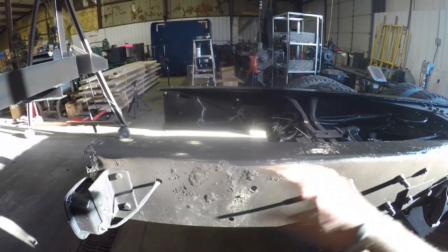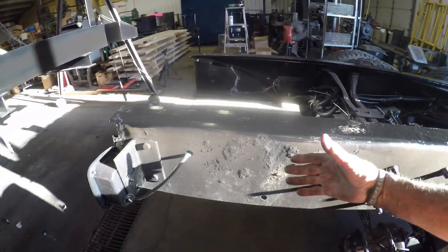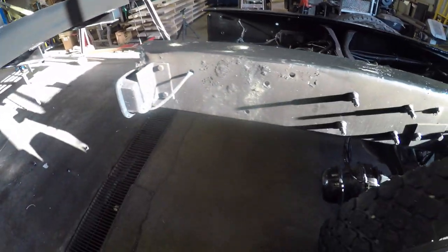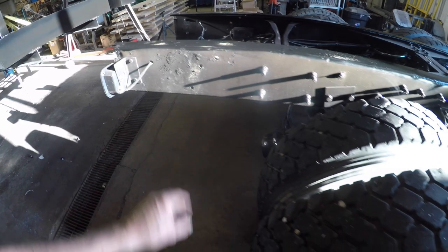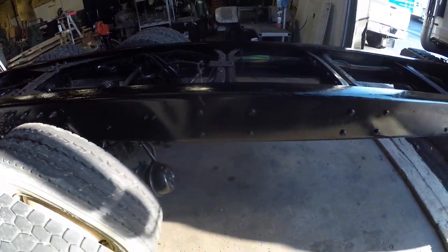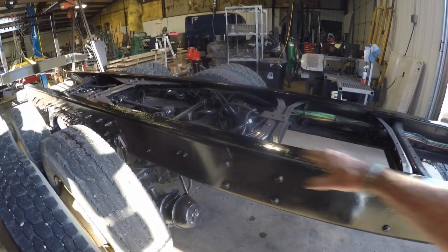I didn't take the entire surface down to bare metal. Besides that, even if I did take the surface down to bare metal, the sides would still be painted, and the POR 15 would react with that paint. So I use Rust-Oleum because it's enamel, and because enamel can be painted over anything. What I did is just use the Rust-Oleum, put 2 coats on the top, just sanded down the top.